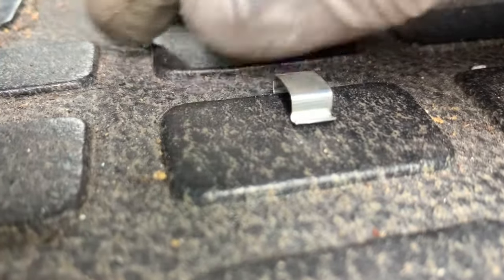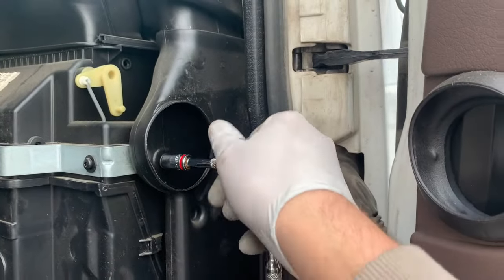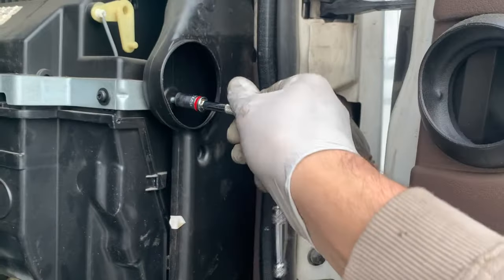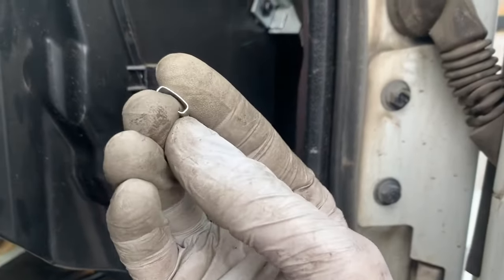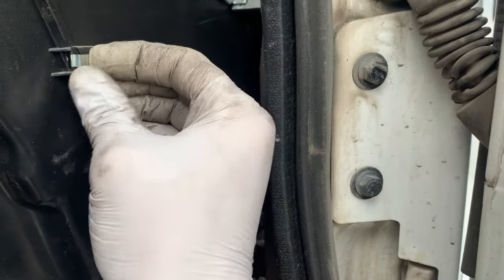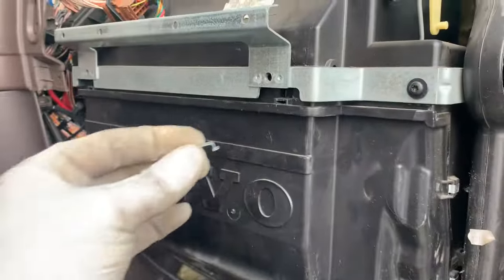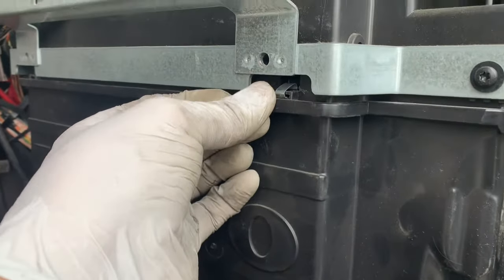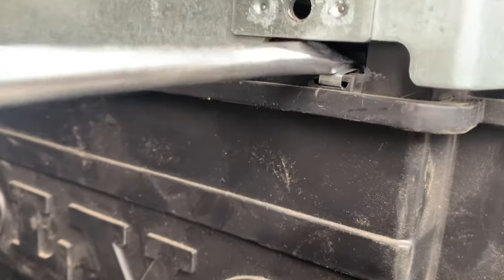It's going to be a lot easier — that's the way you have to put them, otherwise you'll fight it really hard. This one first, this one second. To make it easier, you have to remove one more nut. This end goes first, this goes second — just like this. Then push it in just like that and repeat the whole process for the whole cover. On the top, go with this end first, then take a flat screwdriver, push it in and turn it. That's it.